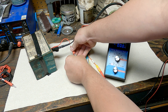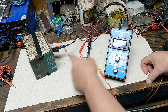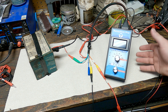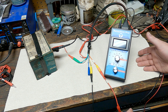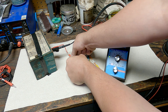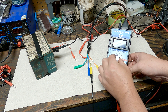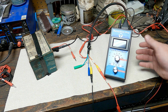As soon as you have a path to ground, the fault light goes away and the voltage goes away. If there's an open and you wiggle the harness, you might see the light flicker and the voltage drop as you make a partial connection — making it quick to find the problem. Now I want to demonstrate fault protection. If I have an open and a fault light, the voltage here is 11.8 volts versus 13.6 on pin 30 — that difference confirms a floating ground, not a short to battery voltage.